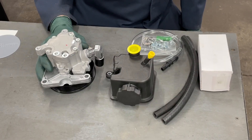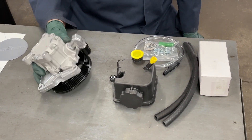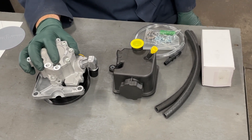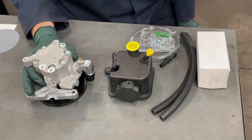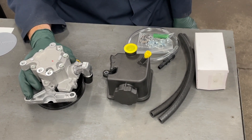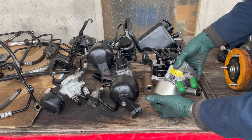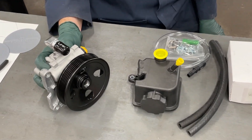This is one I really believe in, and it's becoming a very popular kit on my website. I know a lot of people, when they do the coilover conversion, just leave the original tandem pump in place and plug off the hydraulic lines. The problem with that is: what if those hydraulic lines start to leak, what if the pump starts to fail? It's already old, makes a lot of noise, it's heavy, puts drag on the engine. I couldn't believe the difference in acceleration when I got rid of all the weight from the ABC system and got rid of that big heavy tandem pump.